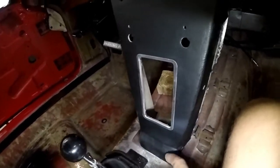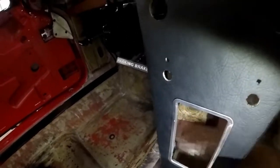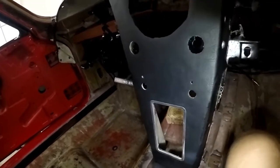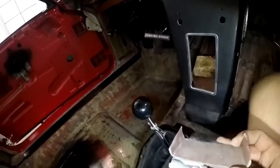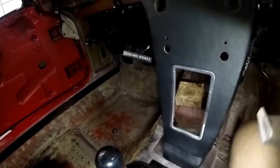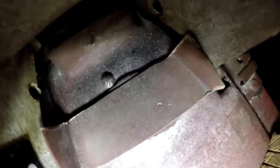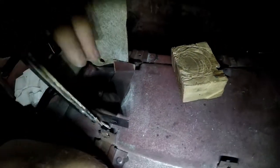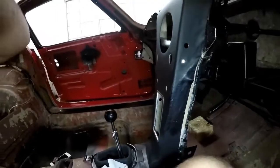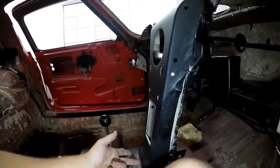I have the floor scuffed for both the front boss and for this bracket, and I scuffed the back side of the dash and the front and sides. This bracket takes the same contours — there's a dash rivet right there, so it has an indentation in it. I wanted to leave a little of that so it acts kind of like a key, sliding right where it was. I'll bond this in first, let that sit for a minute, and then bond the dash in and slide it over until it stops.